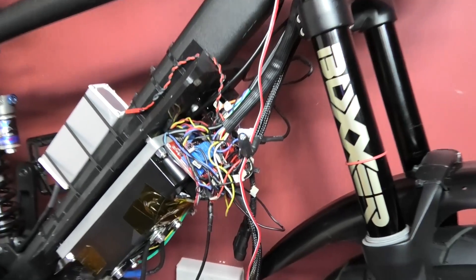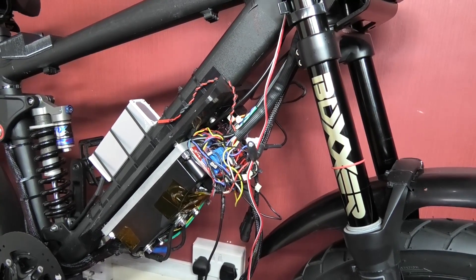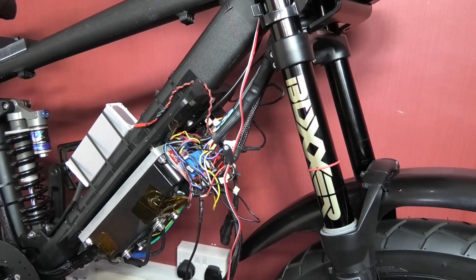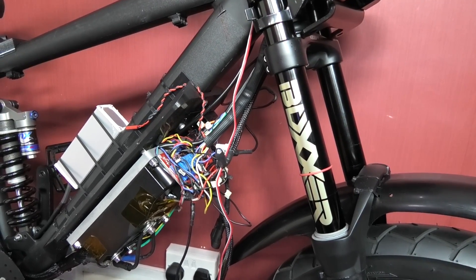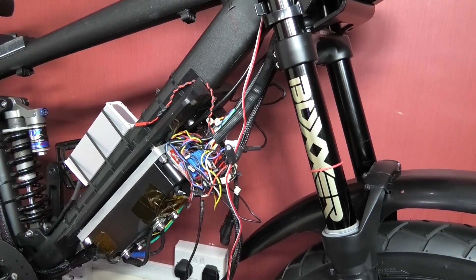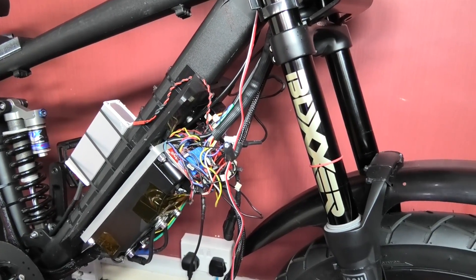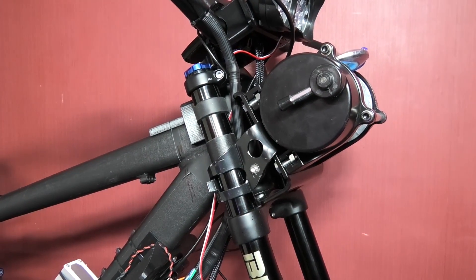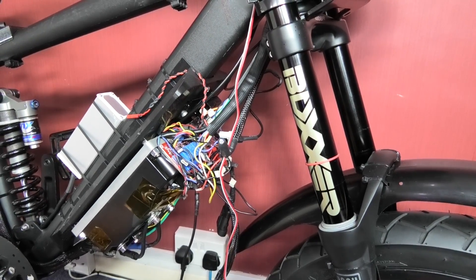I'm not afraid to show a mess. When I did some full testing — suspending the back wheel, opening the throttle, checking the lights — I found a problem. When I open the throttle, the hazard warning lights come on (they're not actually fitted yet, but they show on the clock), and the headlight starts flickering, coming on and off randomly.